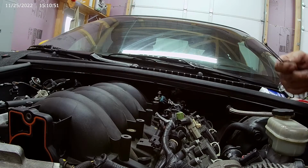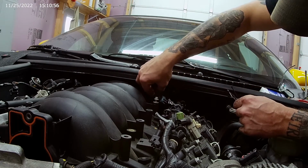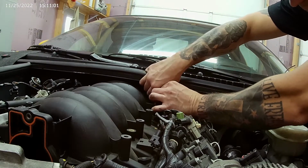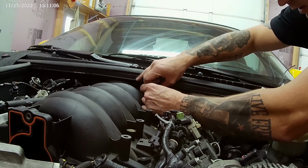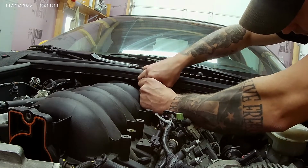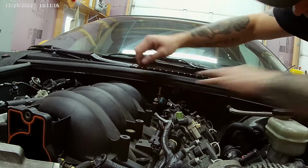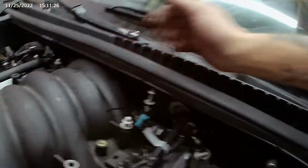What we're going to do is we're going to pull this bolt up to the point where it's almost in the cowl, right? We're gonna figure out where that point is. Now, I know you really can't see crap because I'm cheap and I'm working on budget camera. We're in the process of getting a new one. If 40 people watch the next video, I'll definitely buy another one. Now, you see the zip tie is being a buffer and holding my bolt up. What that's doing is pulling it up so it's not hitting the hole so I can slide this back.